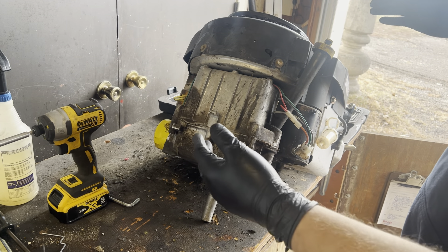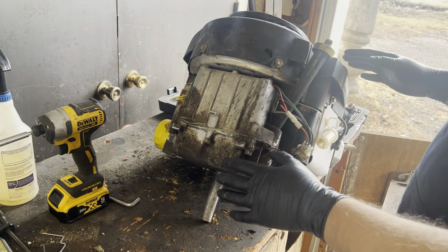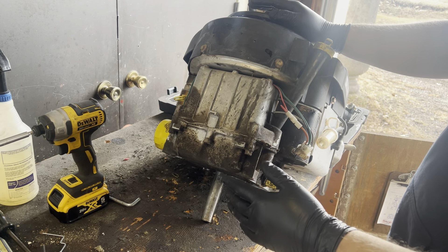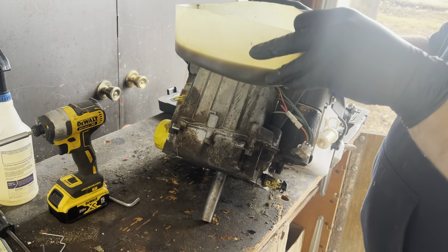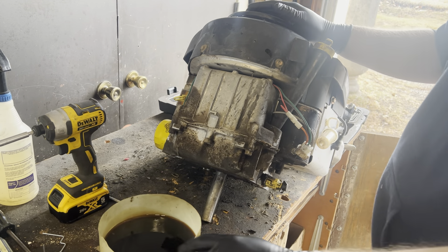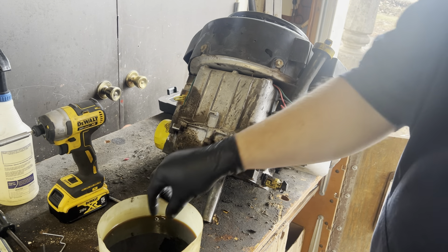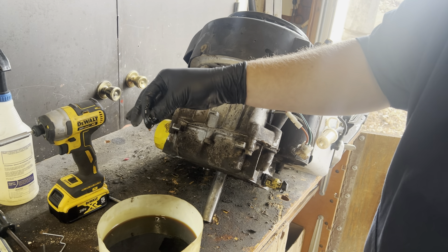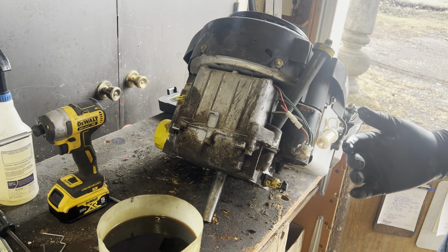Good engine when it first came out, but we're going to tear this guy down and show you the big differences between the Briggs & Stratton Intech and Pro Series engines and your Kohler engines. First of all, this is all the oil we pulled out of her — not much more than a half quart, and this engine needs about one and three quarters of a quart to be full. I don't think it's supposed to be the consistency of honey. I'm willing to bet we've probably got some nice galling going on in there.